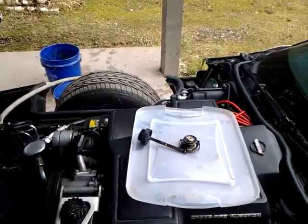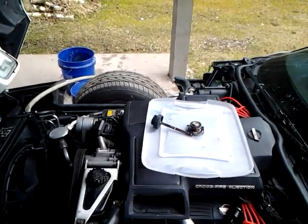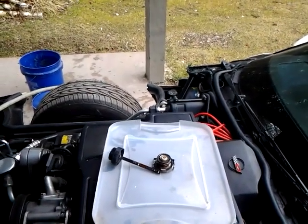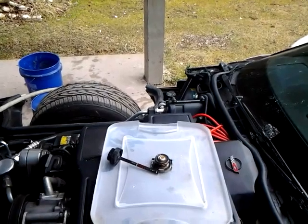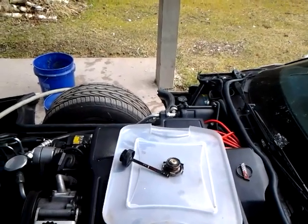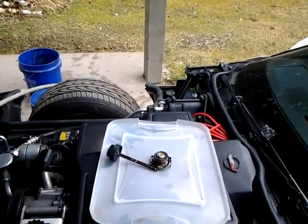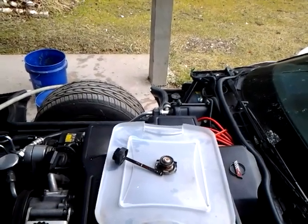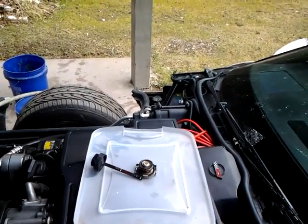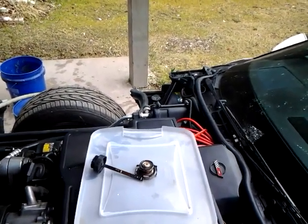It's getting old — it's an 84, it's getting up there in age. I replaced those heater core hoses about 15 years ago, and every once in a while I hit them with silicone or Armor All or something, and I say I never want to touch those again. Because from the old cars, when you take the heater core hose off, you really take a nice sharp knife and you cut it, you split it and peel it off — never tug on it, because that's for sure how you're going to break the heater core. Even then, I just don't like messing with them, because when they start getting old, you just touch those and they start leaking.